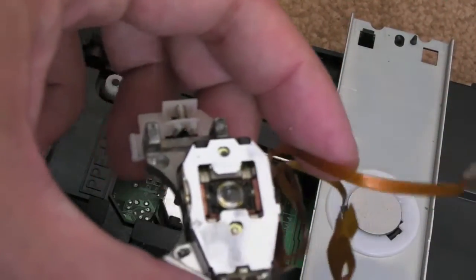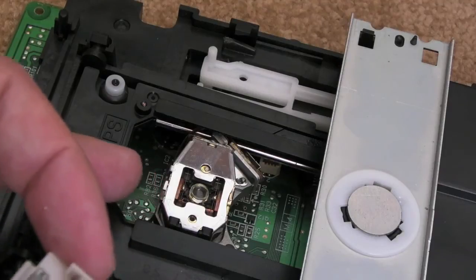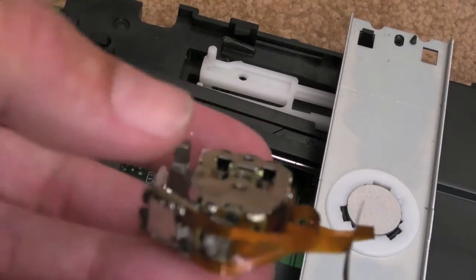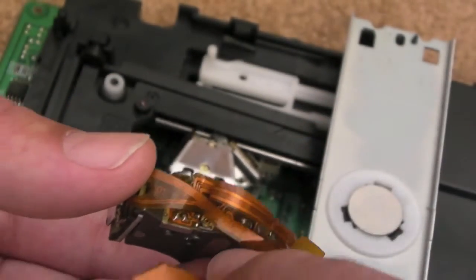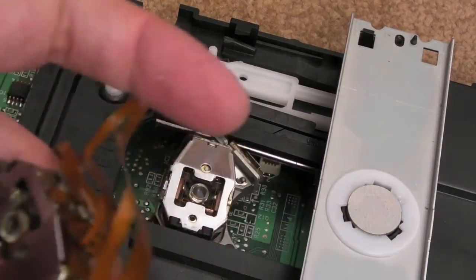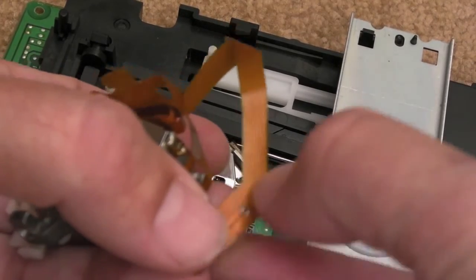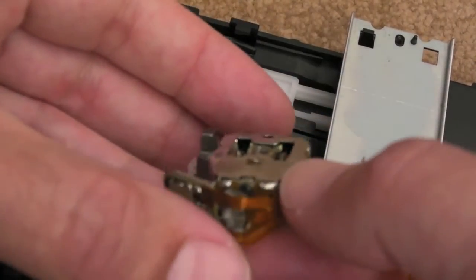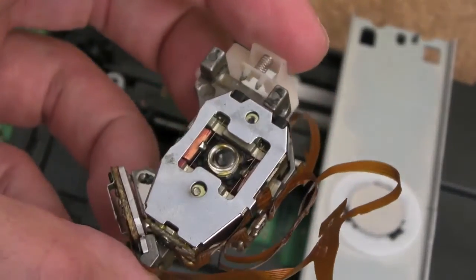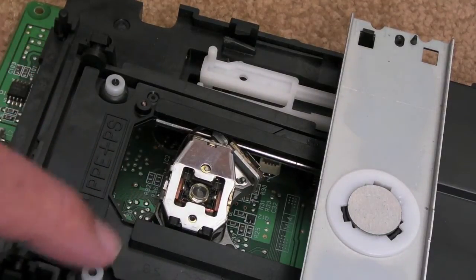I think this laser is a Sharp part. One thing you can run into if you're not careful is the size of the four-pin connector and the length of the wires. Now, when you start running into problems and you've got a new laser on it, the temptation is to start adjusting the laser voltage — there's a pot on here. But that's an absolute no-no — do not do that. These lasers usually come calibrated to the correct voltage 99 times out of 100. Someone has tested it — the anti-static blob was removed and I haven't had to do any adjustments. It just works.